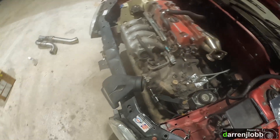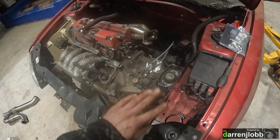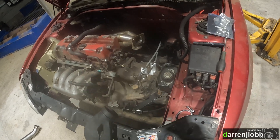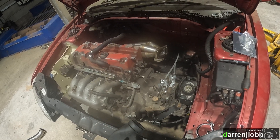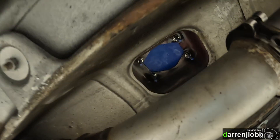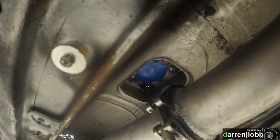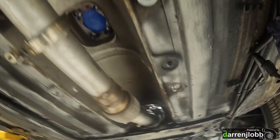I think we should be able to go in and around but sweep into the other side of the gear stick rather than coming in from the passenger side. So I'm going to get the turbo refitted now - obviously still no gaskets or anything because all of this has got to come out again when we refresh the engine. Then eventually it'll go back together with everything new. I'm going to bolt the turbo in, bolt the downpipe all up, connect the original exhaust, and make sure everything's got clearance. I've just fitted that blank plate and adapter plate for the gearbox - you can see from underneath it's just blanked right over that factory hole, picking up the original bolt holes that held in the original shifter. So this could all be unbolted and the original setup put back in.